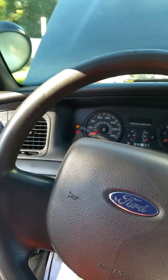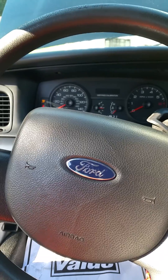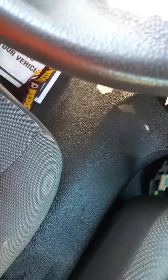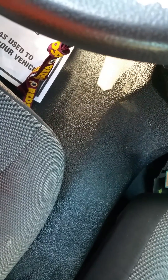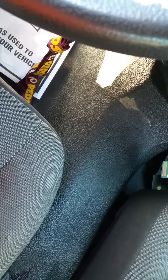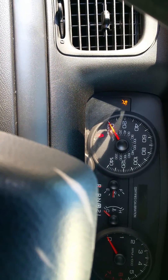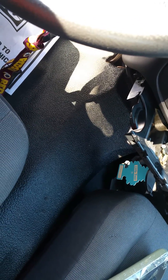Most sources said it was the driver's side, however some forums said passenger side. I'm going to test the circuits on both. I'm going to remove the seat belt pretensioner — basically the seat belt buckle and the harness — disconnect it and test it. My scanner did say driver's side, and they say that's the most common one to go bad. If the driver's side shows a negative read on the multimeter, I'll replace it. That's three pulses, pause, then another three — one, two, three — and then the light stays on.